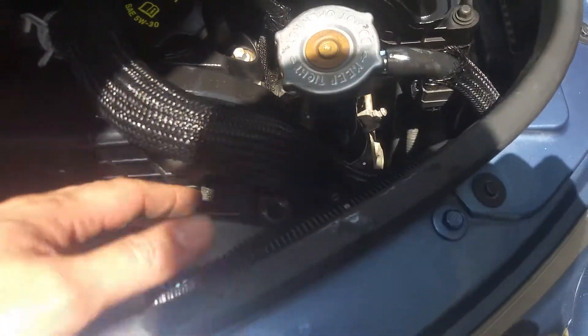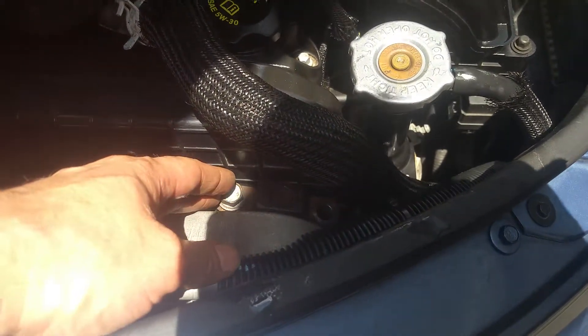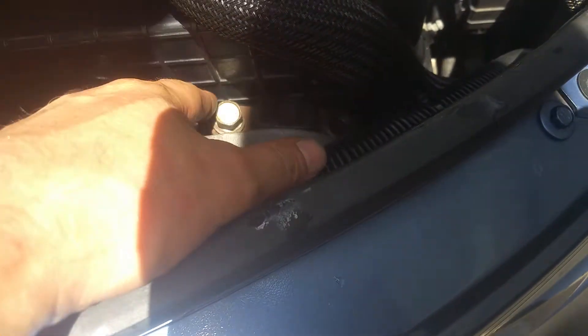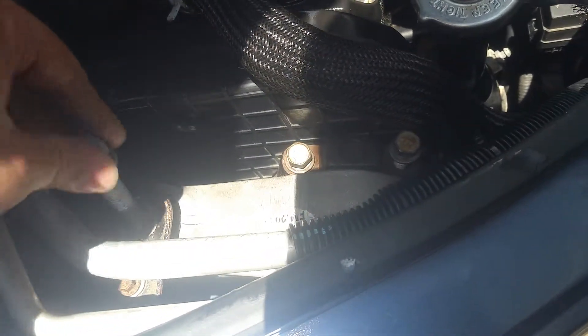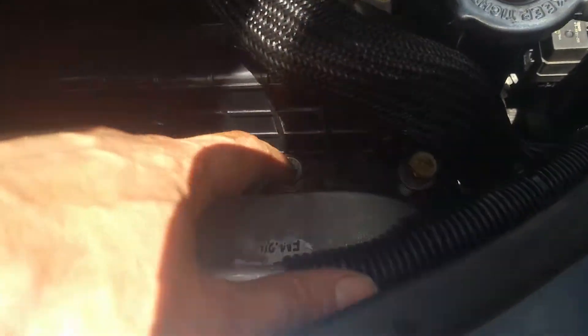One thing to note when putting this in — nothing is ever perfect. The engine shifts and stuff when you take the old one out. Now, this front part of this will try to cock up a little bit when you go to putting your bolt in. You can take a screwdriver or something and just push down on it — it will push down easily. The main thing is these bolts will try to follow the holes on this bracket, and if you're not careful they will try to cross thread. I had a situation like that before — so make sure you don't get those two 15mm cross threaded, because then it's going to be a nightmare and you'll have to re-tap the threads and possibly replace this front cover. It's not so easy with bigger bolts like this 18, but with smaller bolts like that it's easy to get them crossed. Start whichever one it's tilted toward, flatten it out, and just make sure you don't get those cross threads.